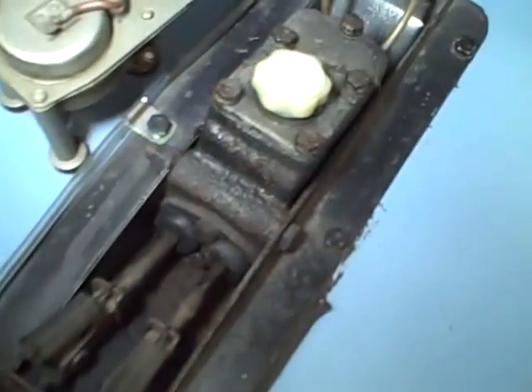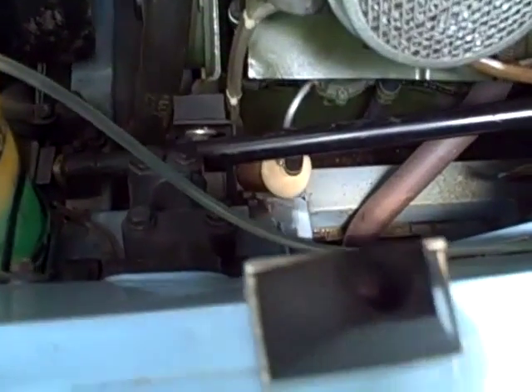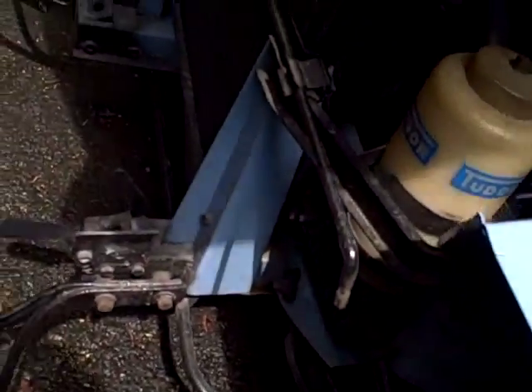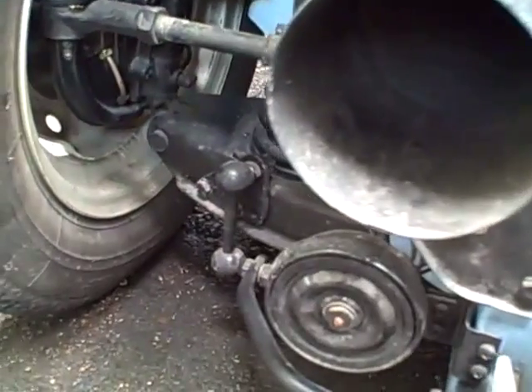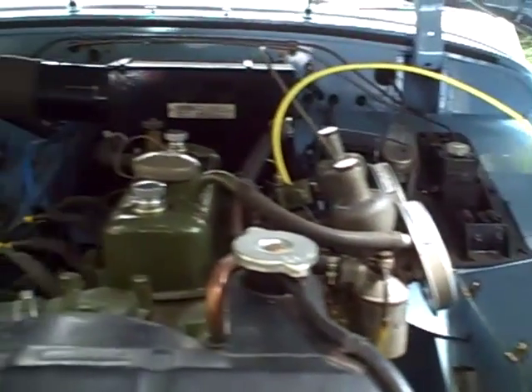Slight downgrade for this master cylinder — not quite as tidy as we might like, but it's not very hard to paint and clean up. The way the new brake and clutch lines run is nice. It's a very simple engine and layout, and you can see that here. There's a fuel filter added on the inside of the fuel pump, and the proper exhaust pipe running through. These are the correct rubber towers for the bonnet, and there's a wonderful latch down here for the nose that hooks up into the side of the nose — that stops the bonnet from lifting up on the wind and slamming down, which is a nice safety feature. There's the horn in the right place, and there's also an anti-roll bar installed. Overall, a really beautiful restoration done right from BugEyeGuy.com.